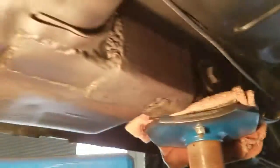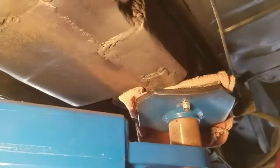Early cars had the fuel line running down the inside of the tranny tunnel. This is a late car, so it wasn't always exactly scientific. There's also a line running up the rocker panel. We've got a little bit of exhaust with the correct style hangers running back, and then we're into a transverse mount muffler — that's a replacement unit. Back up to the floors and rails though — no real evidence of any kind of replacement. Right here you can see there's been some steel welded on the bottom of that rear rail — I'm guessing somebody had a set of traction bars back in the 60s or 70s.